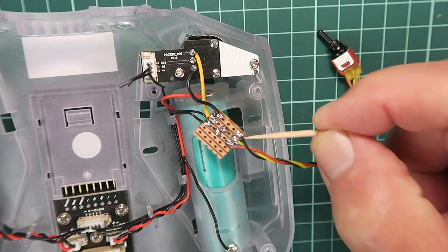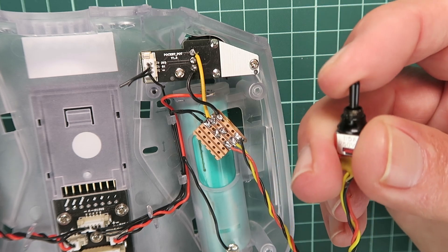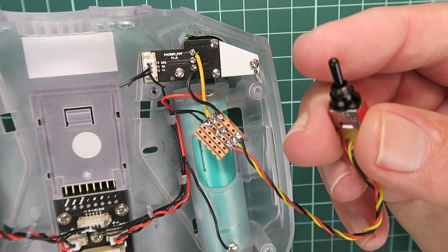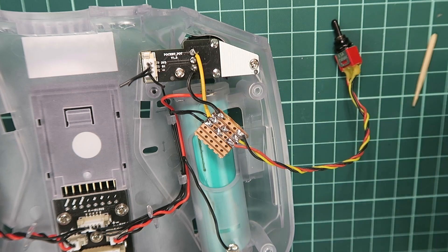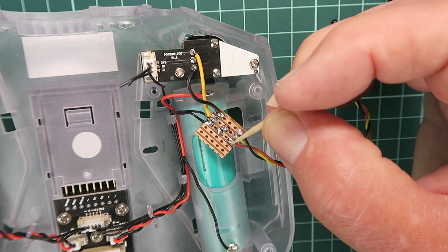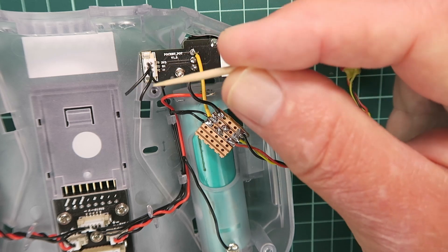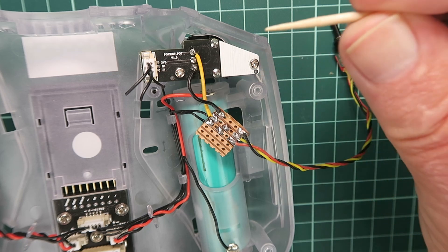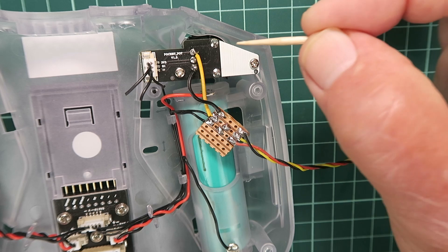Here we can see our switch wired up to a little piece of Vero board — prototyping board. The little switch I'm using, a three-way centre off, is sold by RadioMaster as a replacement for the Zorro transmitter — very small and neat, ideal for our purposes. As always, links in the description. The centre terminal is on the yellow wire, black chosen to be negative, and positive there. I've just cut the signal wire and the nominal 3.3V off, attached down there so I can replace the potentiometer in the future. Two connections to either end of the 10k pot make it just a fixed resistor — and that's all there is to it.